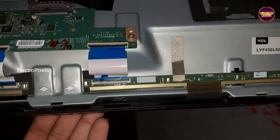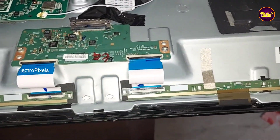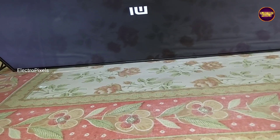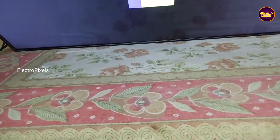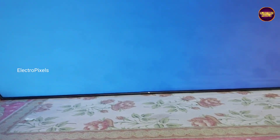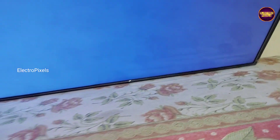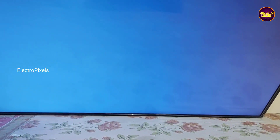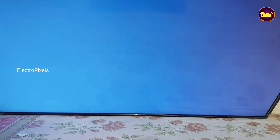In this situation let us release the TV from standby. Finally, picture comes and the TV is back to normal — the picture is crystal clear. But remember, this is just a temporary solution; the permanent solution is always panel replacement. We can't predict how long the display will work using this method — it completely depends on the user. It is now confirmed that panel shorting is on the right side, and the panel short removal is successfully completed.